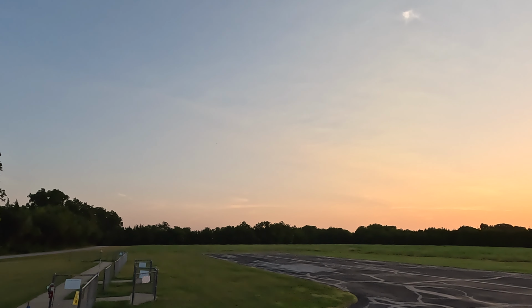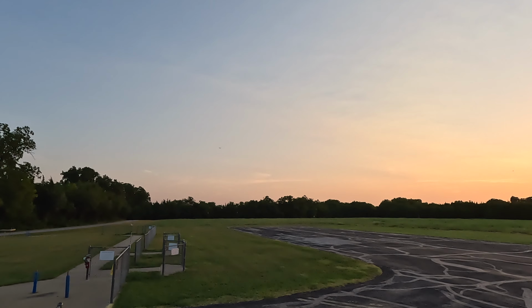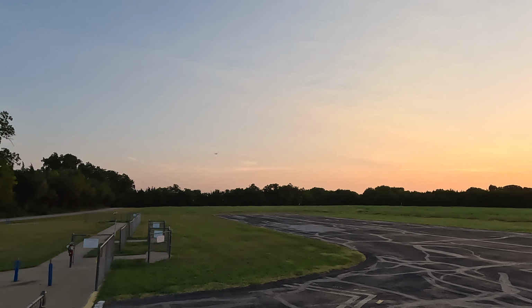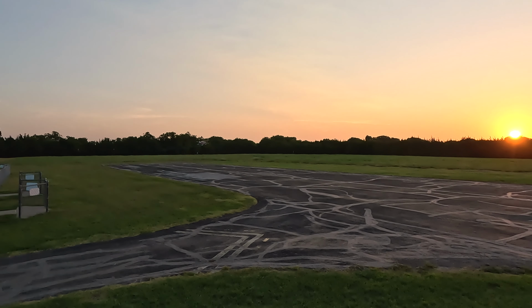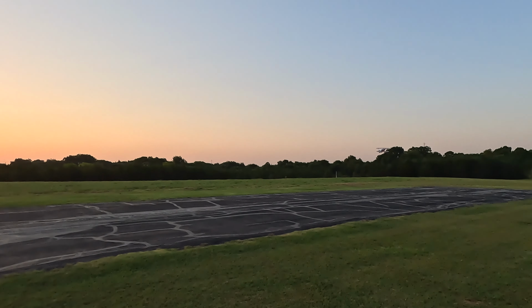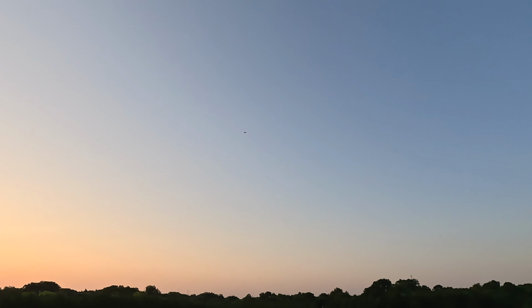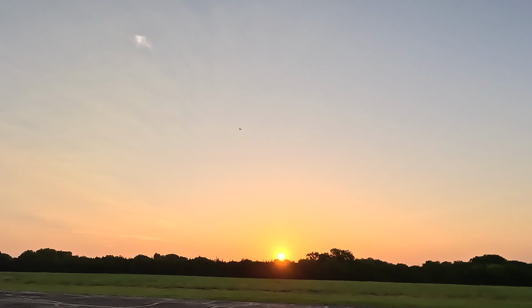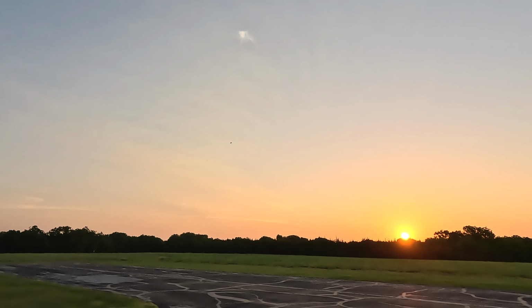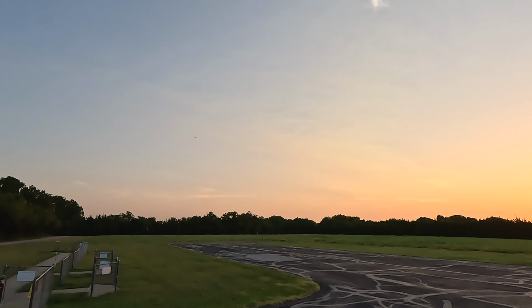Glide. A lot of wind picking up now. 3 minutes. Still running. First two flights I had it still pretty rich, and this time on the tach, leaning it, I was peaking at about 7600 RPM.